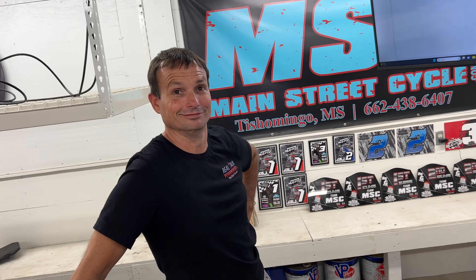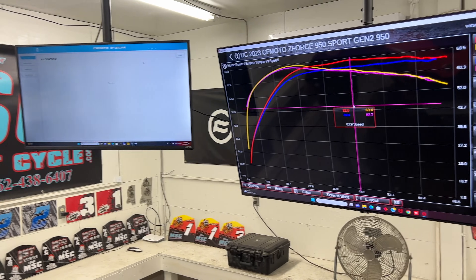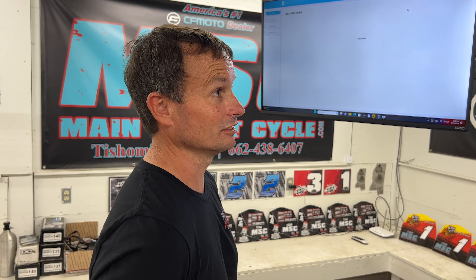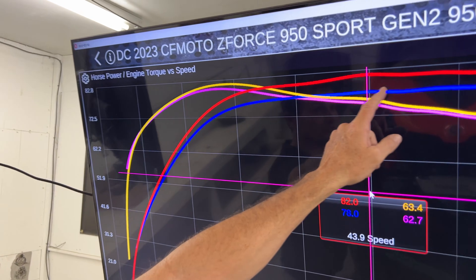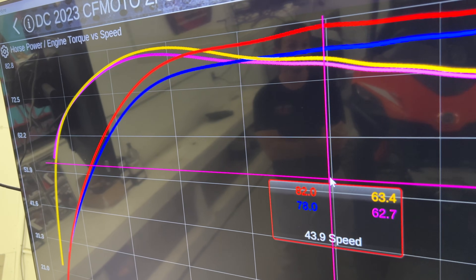Enough of me rambling. Dave, tell me a little about this tune — tell the people what they can experience, some of the things you worked on, the smoothness, adjusting the map, the AFRs. This one was a little lagger bait — it was hard to get power out of this one. It really runs good from the start. So a lot of timing adjustments, a lot of air fuel ratio adjustments. Wasn't a lot to be done with the torque tables on it as far as picking up with it, but it turned out real good, especially through the mid-range. It picked up power from the start all the way to the end. Big numbers in the mid-range — more than we expected as we started tuning this unit.